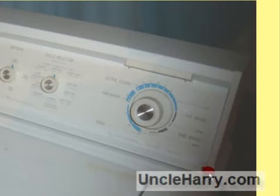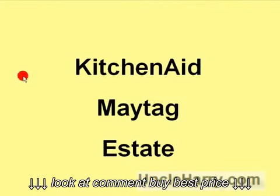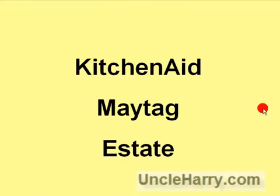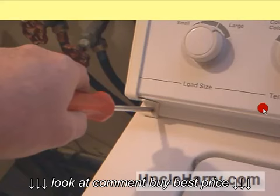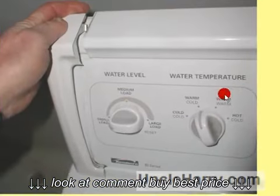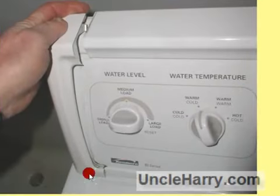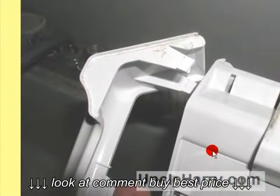And the secret is that screw and that screw right there. This washer also comes out as a KitchenAid, the brand new Maytags, and an estate washer. By taking those two screws out that I just showed you, you can flip the console back like this. The screws sometimes are hidden behind this trim piece, particularly on Kenmore's. With that trim piece off, you can access the screws.